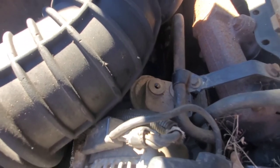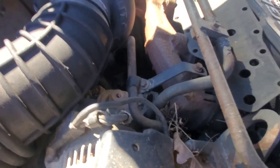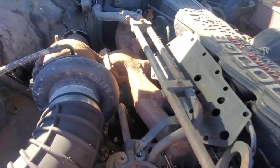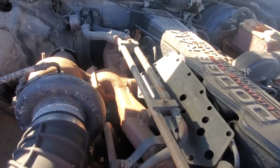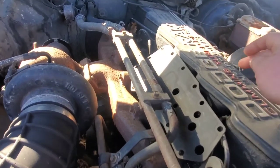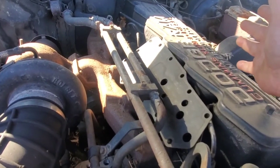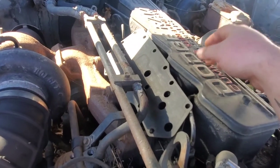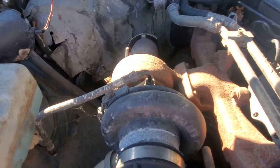Once they put the cooler on it, they started putting coolant in it and they could hear it kind of raining down inside the engine once it got about three-quarters full on the radiator. They pulled the drain plug out and it's just raining out of the drain plug hole. These have some freeze plugs in the heads, so I'm hoping it just popped one of those freeze plugs and I can jam another one in and call it good. If not, I'll have to pull the cylinder head and see what we can do. It's got the itty-bitty baby turbo.